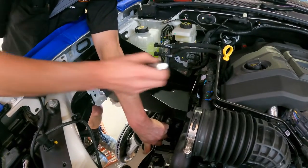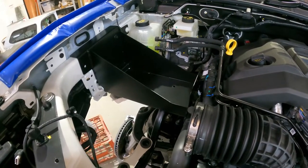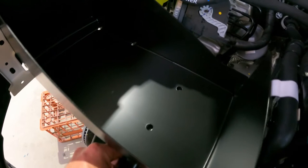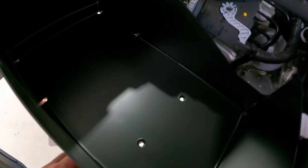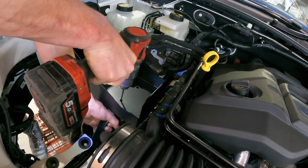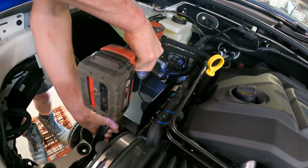I've marked where to drill the holes with this white marker here. I'm going to be drilling through with a 7.5mm drill bit and then going to be using a self-tapper, or what's called a pinning bolt. This bolt is going to go through the arm — the arm's pretty thick, like two and a half to three mil thick — so it's going to tap itself a nice thread through here. You could get away with maybe some urethane or something; it's really just to stop the two from vibrating or bashing, but these bolts on the sides should be nice.